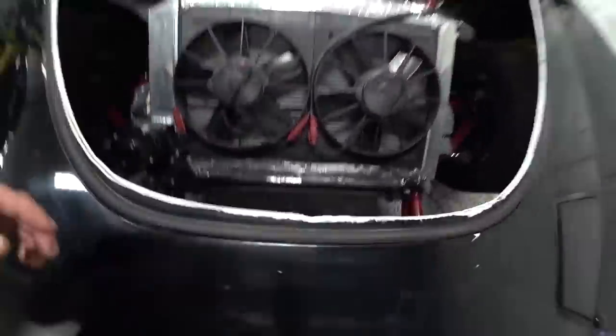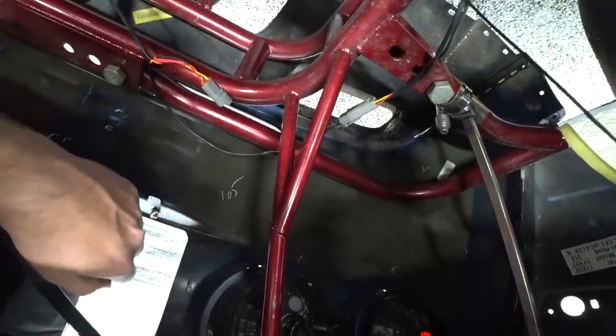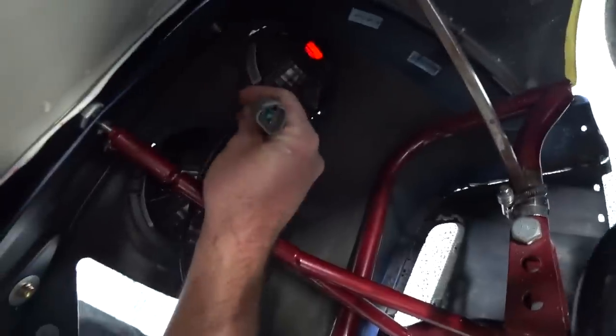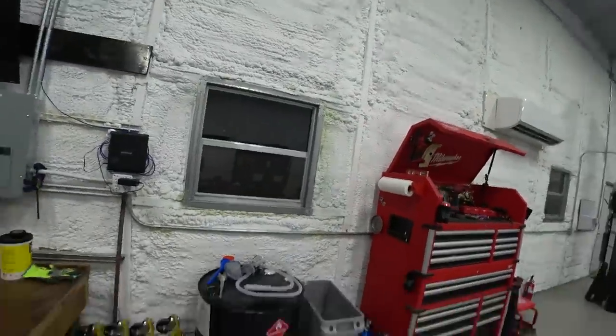Really happy with where we're at — headlight lenses are in and we've got our taillight harness. I made it disconnectable when I built the chassis harness so the sub-harness attaches to the bumper and when you need to pull the bumper it's one connector and it comes right off. Still waiting on potting compound for the stock taillight socket and a switch for the brake lights. We need brake lights working, the Lexan window in, the rear grip kit on, and tires mounted on our new TSW wheels — all before testing in just a couple of days. We've got a lot of work to do, but we're out of time for tonight. Thanks for watching.